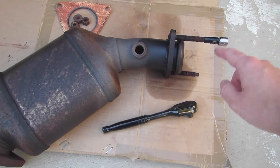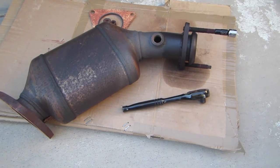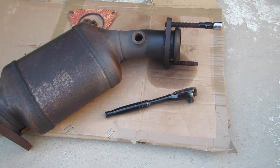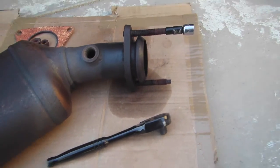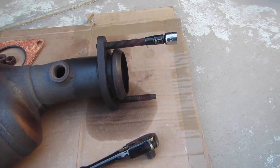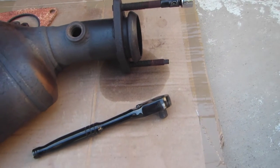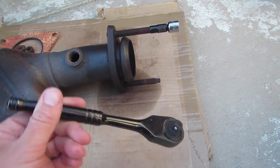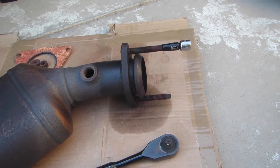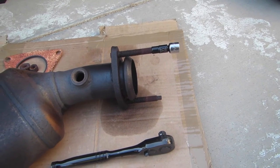I've still got the two studs attached, and I've had a tough time finding replacement studs, especially cheaply. So I'm going to try to take these out and salvage them — maybe soak them in some vinegar to get the rust off. The hex head on these studs is 7mm. In my socket set, the 7mm socket is for the smallest wrench — 1/4 inch drive. I have a 3/8 inch to 1/4 inch drive adapter. I sprayed this down with penetrating oil about an hour ago to try to loosen it up. I'll start with just the socket wrench, and if that doesn't work, I'll throw the other adapter on there and get the breaker bar.